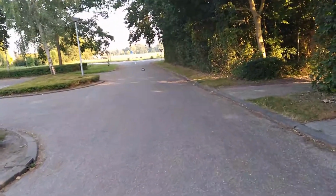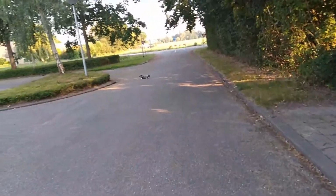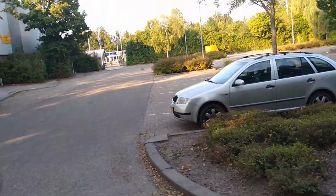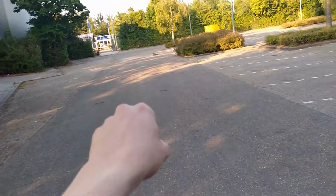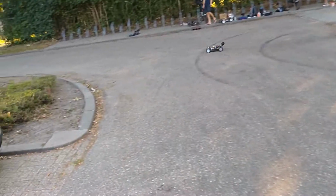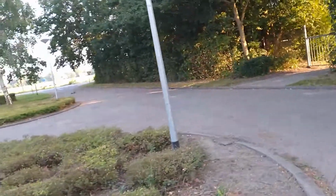That's an LRP 28 in a buggy, people. I mean, he cannot even keep it straight. What the hell is going on? I just tuned this for him. It was running really poorly. Actually, we fried a glow plug too. So we have a new glow plug. I richened it up considerably. Man, it's got some power, people. This thing has power, let me tell you that.